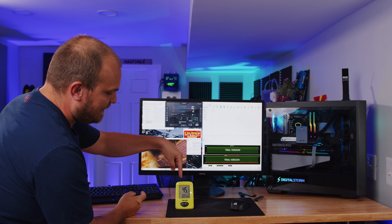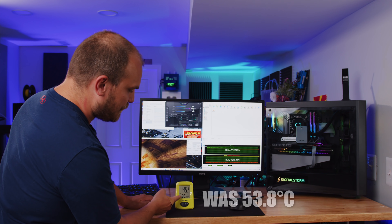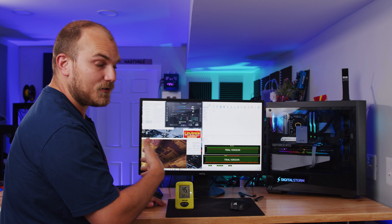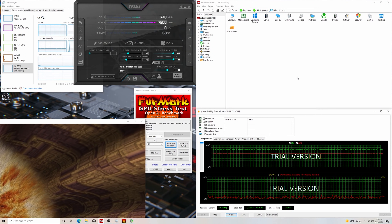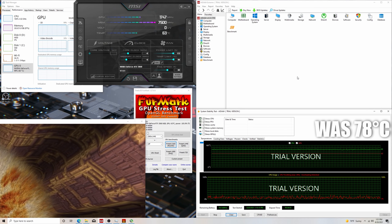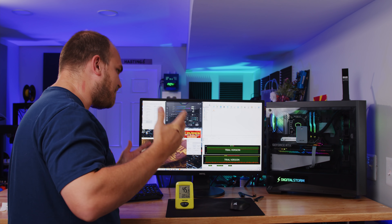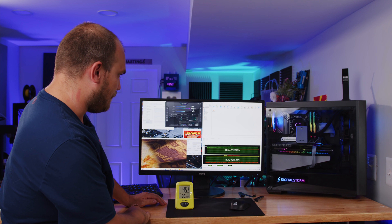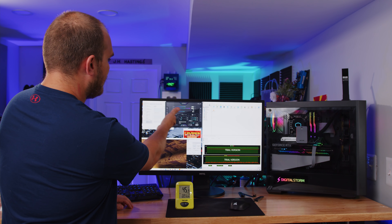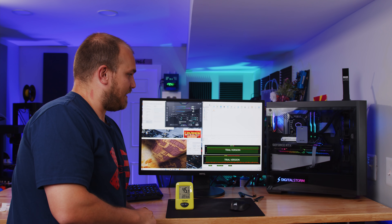Oh my god, I don't know if you'll believe this one — but just look at the case temperature: it's now 45.7 degrees, which is lower than before. Room temperature is 22.9. The GPU temperature is currently sitting at 63 degrees, which is insane considering that in the stock configuration it was 78. I was kind of just expecting maybe five degrees of improvement — but wow. Everything else is the same: running FurMark, running Aida64, fan speed locked at 80%. I think that proves the concept. We just need to make it look not like a dumpster fire — we'll do that now.